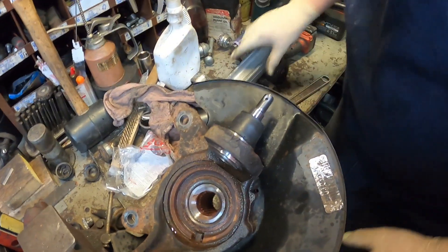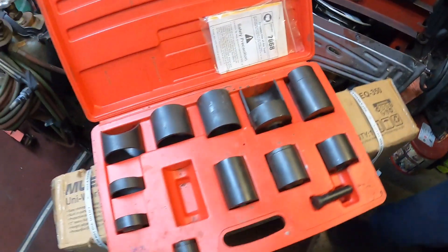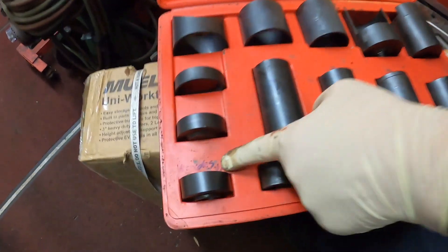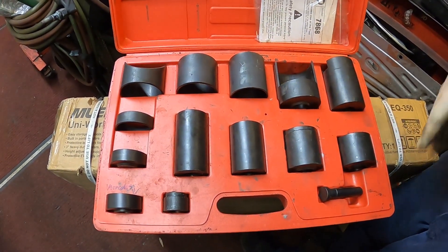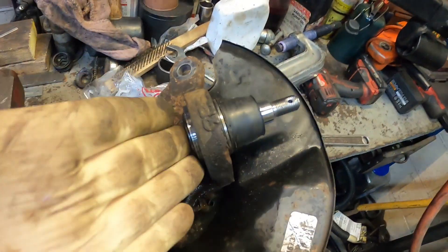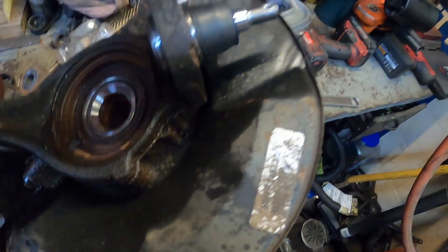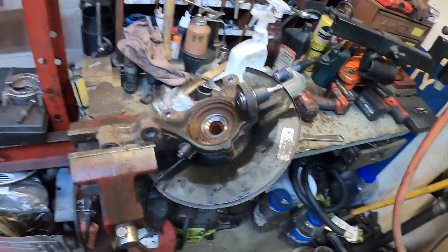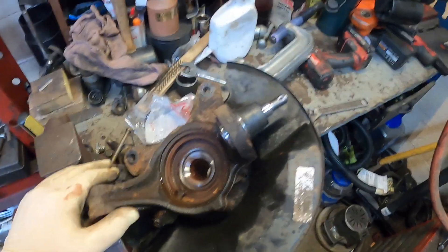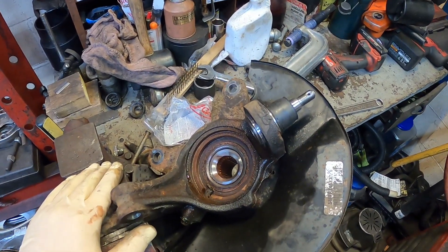All right everybody, now I just have to put the whole car back together. Just wanted to quickly show you that if you don't have all the adapters you need, it can be a real nightmare. This one here is for Mercedes. There's a bigger set I'm thinking about getting. This was a quick overview on how to install a ball joint on a Honda - actually I think a lot of Hondas are like this. Now you just put the CV joint through here, then put the ball joint back in, and the upper mount for the strut, and put everything back together. Please subscribe and give me a thumbs up if you like the automotive videos.